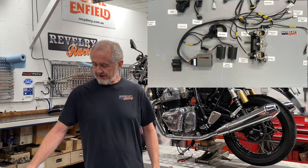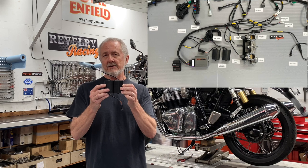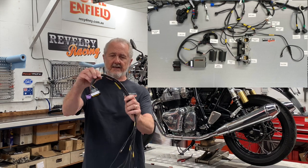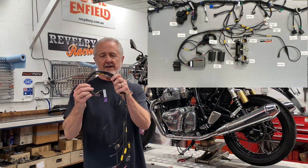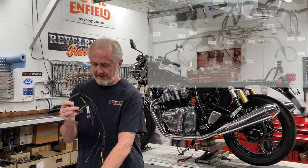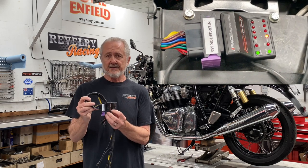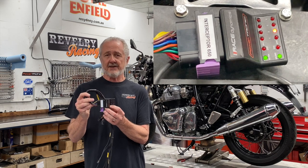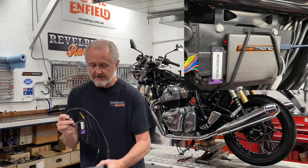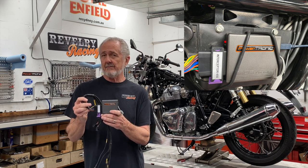Then you've got the connectors for the ignition modulators, and it doesn't matter which one you plug into which side. These are mounted on top of the battery behind the air box, and the connections need to be made there. You route the connector around next to the box where the original tool kit is. The ECU will ultimately be held in place by the rubber band that holds the tool kit in. Before you plug in the ECU, take the stock coupler, plug it into the harness, turn the switch on, verify the connections, and start the bike up to be sure it works. Then shut everything off and switch it out to put the ECU in. Once the ECU is in and everything is strapped down, you're ready to connect to your computer and begin configuration.